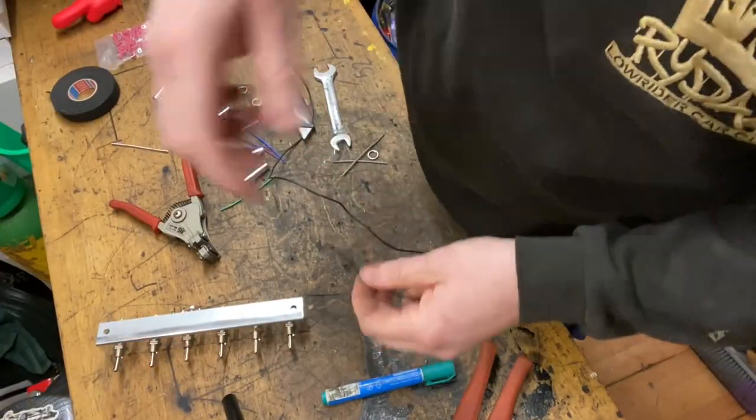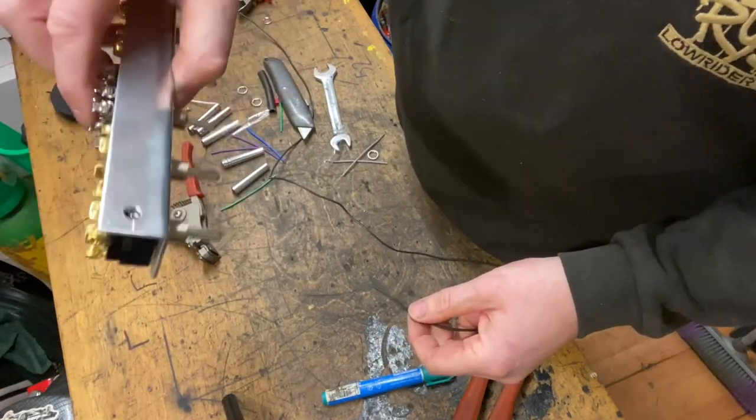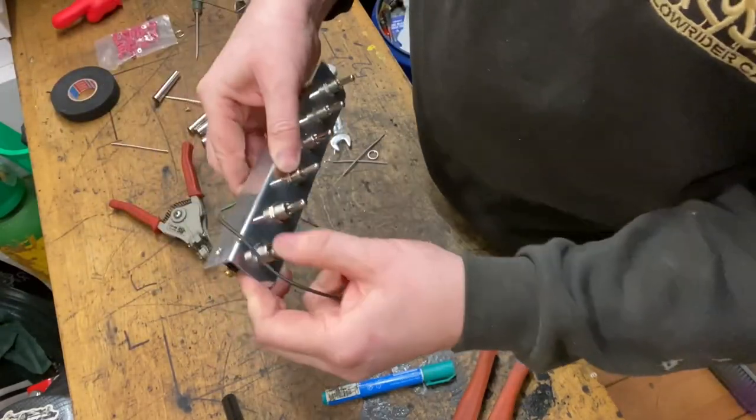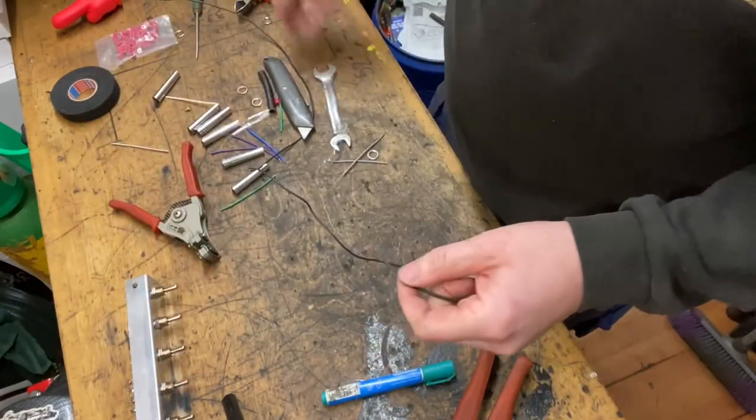Of course, I mean 24 volt. These are 12 volt switches, but we wire them 24 volt because of the voltage drop. When you're hitting switches so fast, sometimes you can end up with electrical issues with your solenoids.